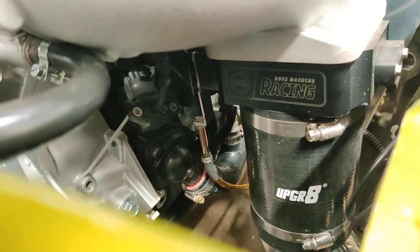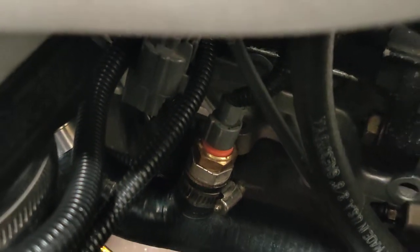This is where I have it — if you look in there, there's a better view right here. The bottom hose — I think that's a K-Tune bottom radiator hose — and it comes with the part where you can put your fan switch. The issue I've been having is I thought it was air in my cooling system, but it's not.